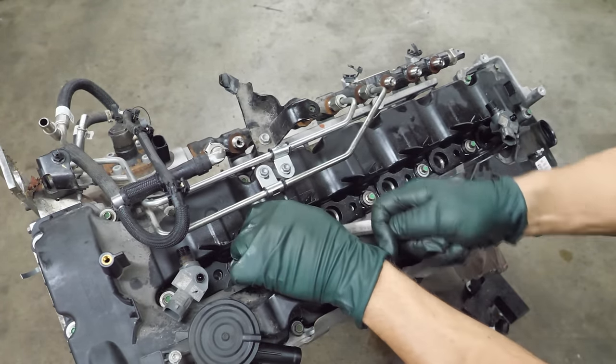As you get towards the rear of the engine, that one's really deep — this piston is wrecked. This is the one from the rod bearing that disappeared. Look at the pretty blue colors — the amount of heat it takes to do that to this much cast iron is wild, that's a lot of heat and friction. I can't really feel too many scratches in the cylinders on one side, but on the other side those are pretty gouged up — you can definitely feel those. I just can't get past how deep those valve impressions are — the force it takes to compress that aluminum is impressive.